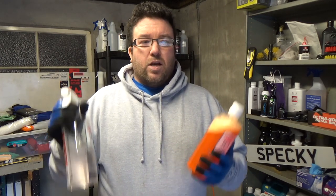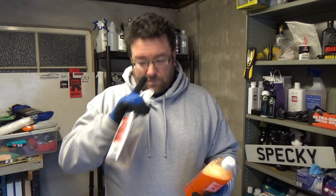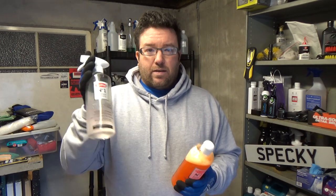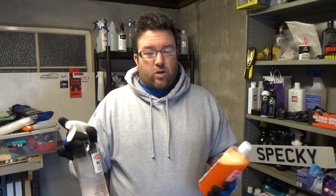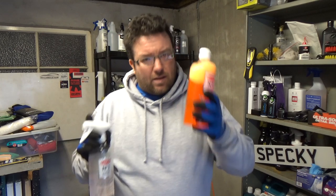As far as I've always been concerned, you wash your car first — give it a pre-wash and a safe wash to remove as much dirt as you possibly can, and then remove the harder-to-remove contaminants afterwards: usually iron fallout, tar, and then anything else sticking to the paint that you can't remove by chemical means, which is when you'd use a clay bar or clay mitt. They're basically saying use this first, but if I spray this onto a dirty car, any dirt on top of the iron fallout will mask it — it's going to be covered, not easy to remove. It might just wash over it and not touch it at all. I would ignore that and say: use the shampoo first. But they say on the shampoo, use the iron fallout remover first, then the shampoo — and I don't think I've ever seen anyone do that.